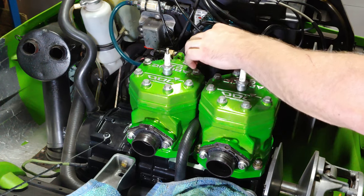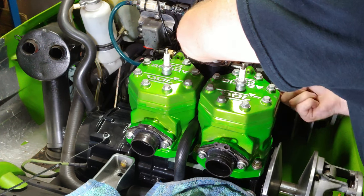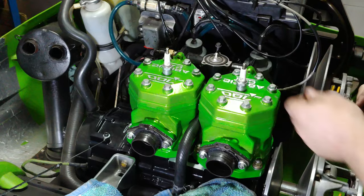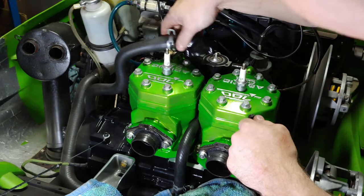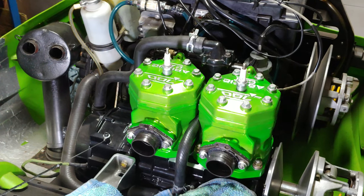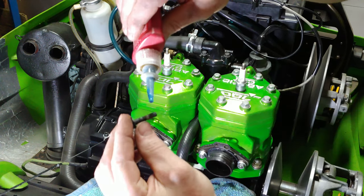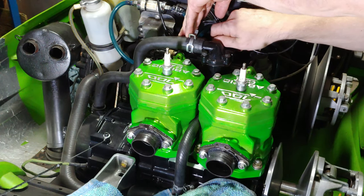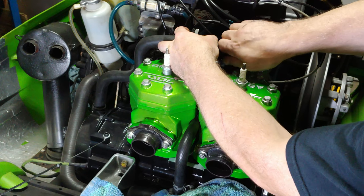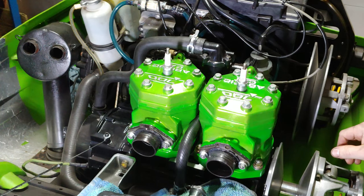All right, folks. Gotta get a hose clamp here. Now we do the top port. It's coming together quick. That's what I love about top ends. Let's get a little blue Loctite, your old trusty 242. These are 10 millimeter sockets, and they get torqued to 6 foot-pound. Not a whole lot. All right, that's that. I believe we just got a belt and some exhaust, folks.